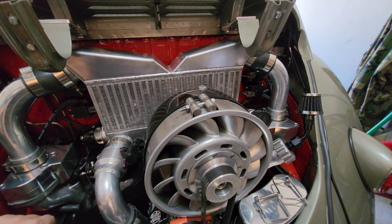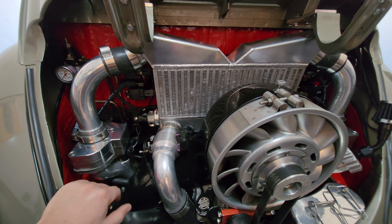I'll probably pull this whole section out - the intake manifolds, the top hats for the turbos, and all this crap coming up out of here so that I can get this done. The motor is most likely coming out too, because it's upgrade time. It's time to do some forged pistons - I'm probably going to do some JE forged pistons. Not that the hypereutectic pistons from AA don't get the job done, because they did for a while, but since I'm in here and going to pull the engine out, I might as well order them. It's about $1,000 for the new cylinders and the forged pistons - JE pistons. You can get those from AA's website, and then we're going to be doing the Total Seal rings again.